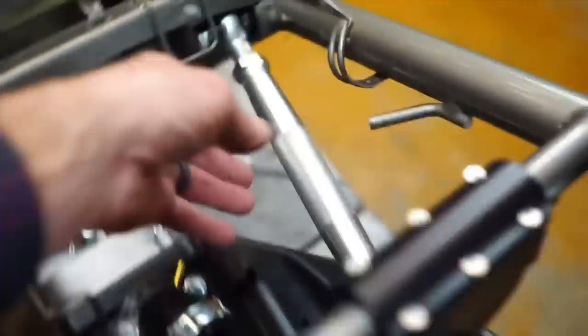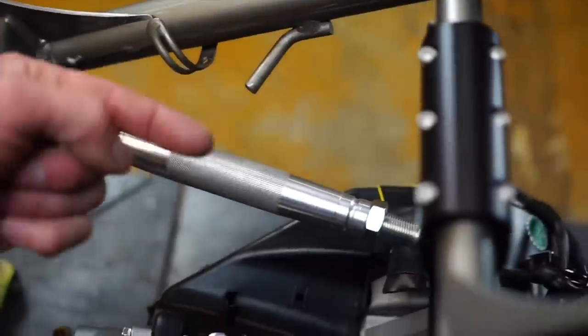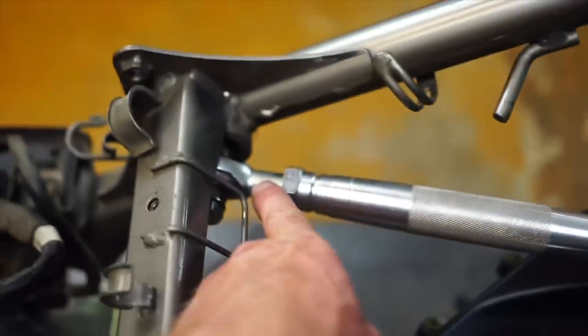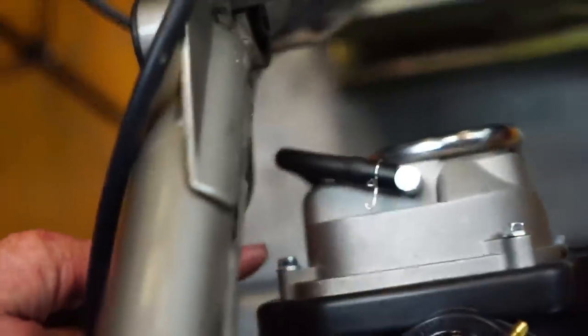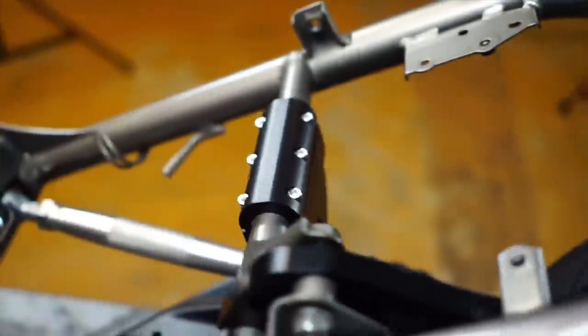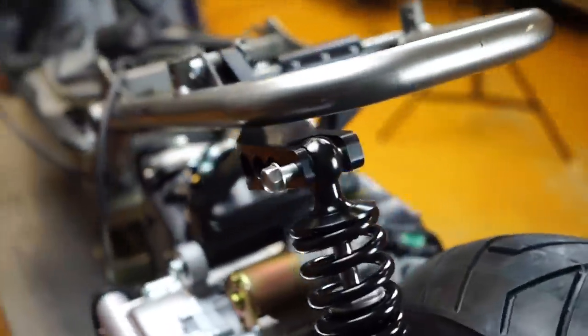This moves back and forth. I have these tightened down, but I can spin this to push the wheel back further if I want, or push the wheel back in. But you can only go so far because you might hit this here depending on your shock height. So all of these things you can adjust and fine tune — this is why this mount is pretty cool, and the style of it is just sweet.